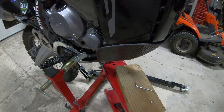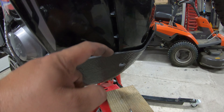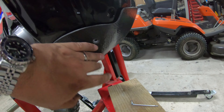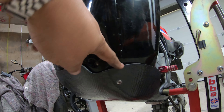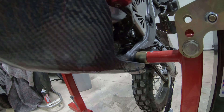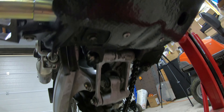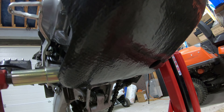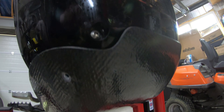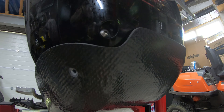Now that it's all assembled, let's give you a look from all angles. It is a really snug fit at the front. They're going to try to trim some of this back a little bit, especially where it extends out beyond the bash plate. Once that bolt is lowered down slightly it will bolt up properly. It's just a really, really snug fit all the way around, extending back nicely. There's a little piece to come off the corner so it doesn't snag the lifting eyes. Regarding rear linkage protection — not really, no more than anything else, but that's a difficult thing to protect. It is quite smooth underneath. The final production versions will be taken from a mold and will have a very smooth finish fitting exactly to the existing Honda bash plate.